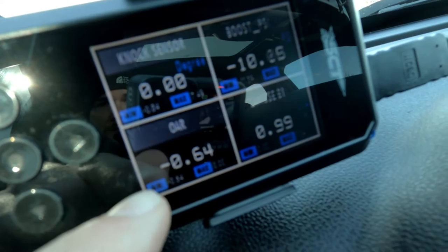What I mean is: the Auto Octane tune has a parameter you can watch when data logging called Octane Adjust Ratio, labeled OAR, and it reads as a negative decimal number. Right now my Octane Adjust Ratio is reading negative 0.64 — you can see it in the lower left corner of the tuner mounted on the window.